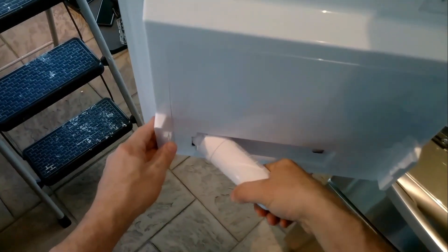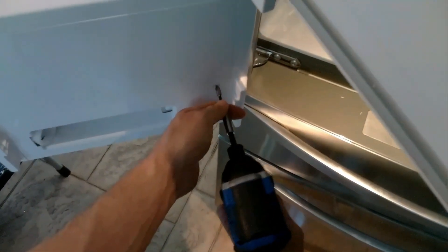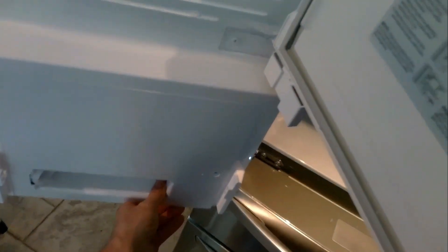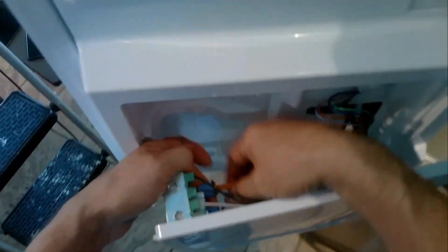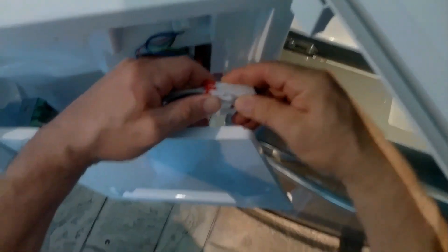Right here we're just going to move the water filter — open it up all the way, turn counterclockwise, and then pull straight out. Now this housing has one Phillips screw here at the door — it's a white screw — and then you'll just pull forward. It'll be clipped in. Behind here you have your water valve assembly, your tank and so forth. This little tank is what holds the water. These hoses — two of them — have little clips that you have to remove, and definitely put them back. This just keeps the hoses from popping out and making a mess. Remove this clip.